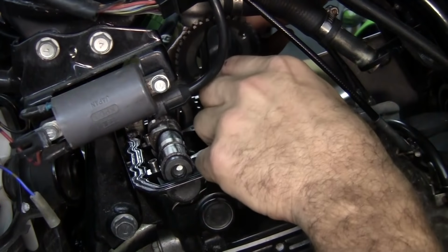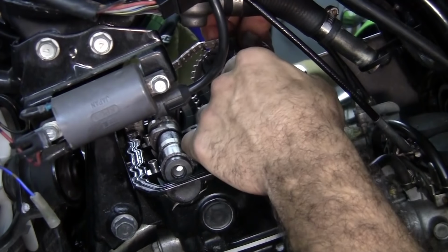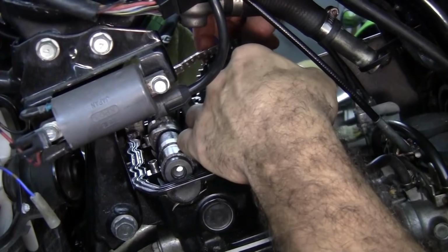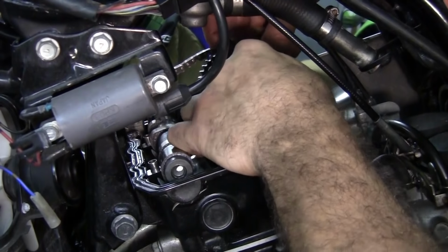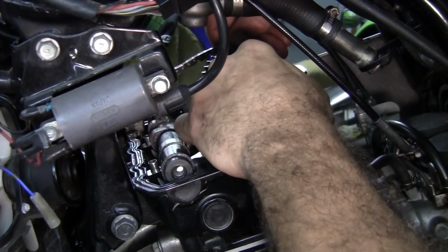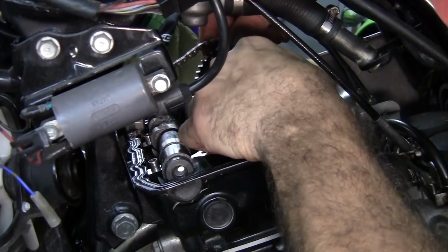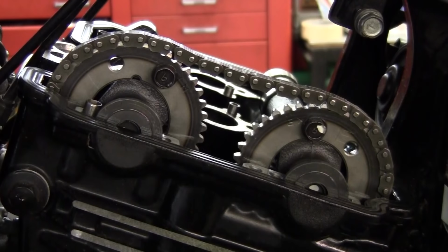So you're going to take that. You know you want to be set up like this, so if you bring it up, kind of roll it in place. Test it out a couple times. Too tight. Go back in 2. Okay, so you got number 2 on top dead center, you got your cams in, and you want to double check.